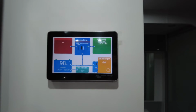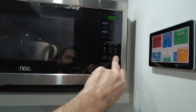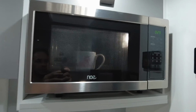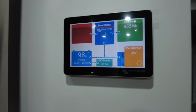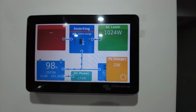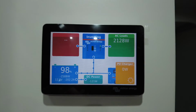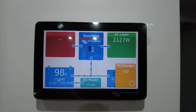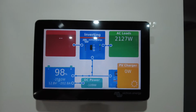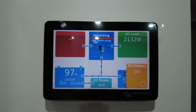Right, so this is the beautiful thing about the Victron setup. If I hit that, that's the microwave and the air conditioner at the same time. I could go more easily. I don't have any appliances here to test, guys, but that's why we're using the PowerPaul batteries, because their continual discharge rating per battery is 250. So this is nowhere near the limit. Absolutely nowhere near it.